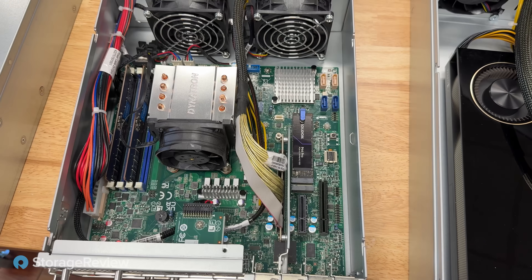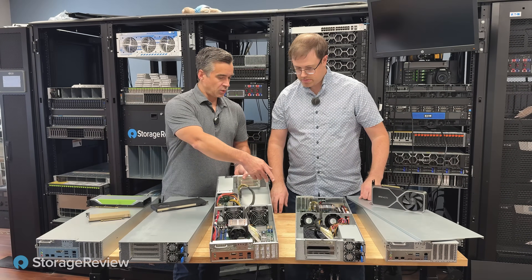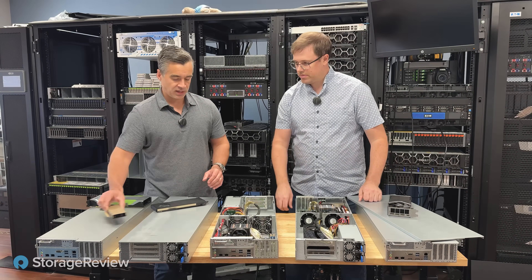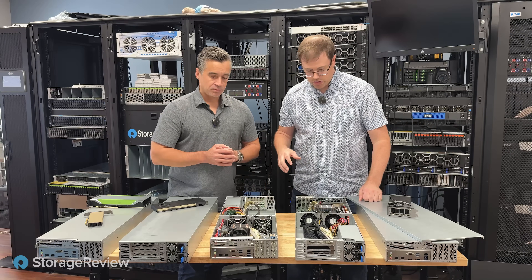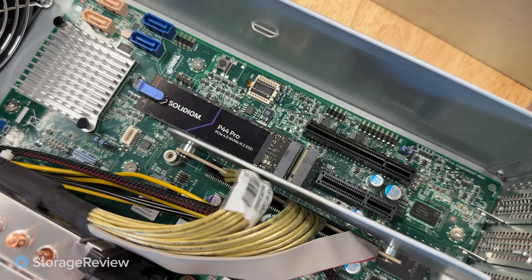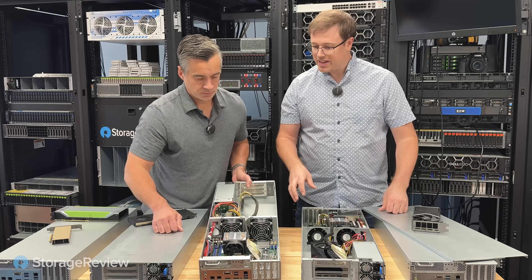What's a little different is you have this PCI cable that goes from a slot in the front to a slot in the rear, so you could fit and cool a full-size graphics card and power it in the back of the system. We've got an NVIDIA A6000 in one, a 4070 in another, and a little L4 for inferencing jobs — it supports a pretty beefy graphics card in the back. For storage, there's onboard M.2 storage. This actually has two M.2 drives that sort of stack on top of each other, sitting underneath a PCI card, giving you some flexibility for additional storage.